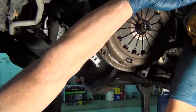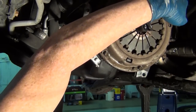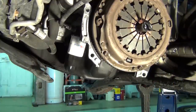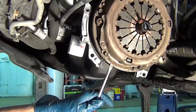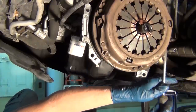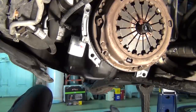I know there's one bolt back here I can't see from where I'm at, but we know there's a bolt there somewhere. What's happening is this is actually stuck on with these little guide pins. I'll grab a screwdriver and pry it back a little bit — you'll see this tool kind of drop down because it'll be free. This one has 188,000 miles on this clutch, so there's going to be a lot of that material, and we'll see it's probably down to the rivets.